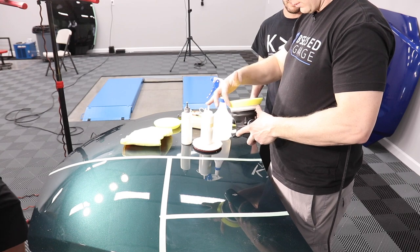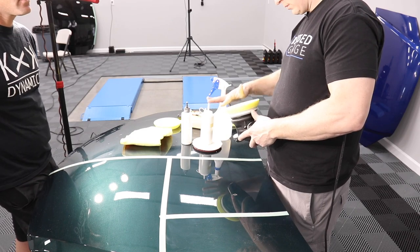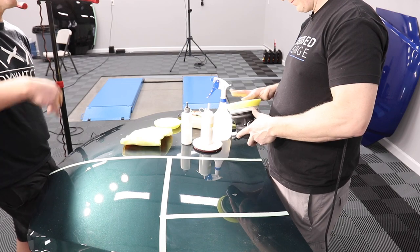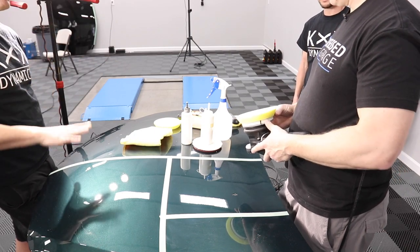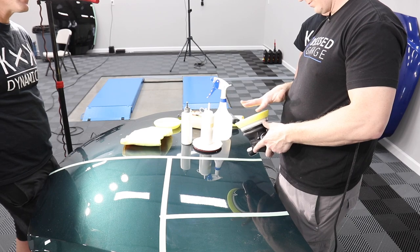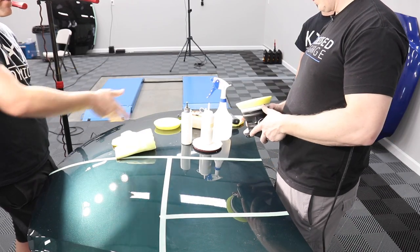That's what I usually do when I'm finishing down a car. I'll start with a brand new yellow Rupes pad, and I'll split the hood in half. I'll do the first half and feel the pad not set until I start doing the remaining 50% of the hood, probably 25% through it. It's all with the feel and how the actual pad is moving with the actual product. Once I feel it set, I know that I will basically just double back and do the remaining.